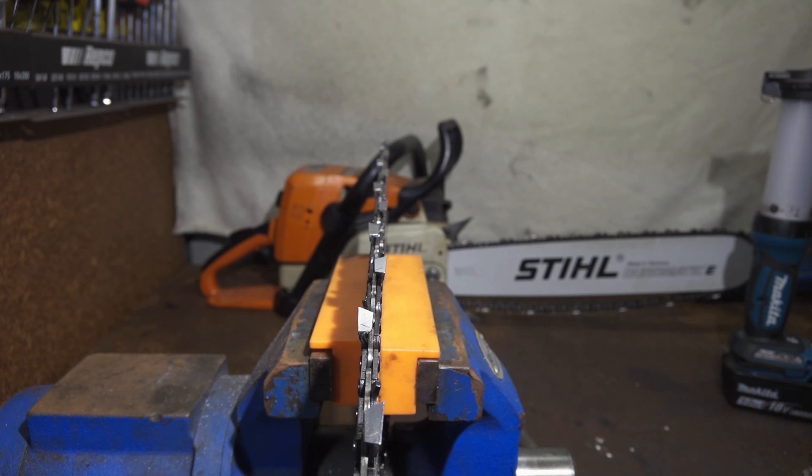Set for saw chain is controlled as you sharpen — the shorter the cutters become, the narrower they become. This is the second part of the reason why manufacturers recommend keeping cutters the same length: they are trying to keep the cutter set in balance around the entire chain. This one we cannot compensate for with anything. Having unequal set from different length cutters generally leads to more vibration in a chain. If you're using a saw only occasionally, you'll probably never notice, but if you're using it regularly, you'll notice the extra vibration that comes from it.